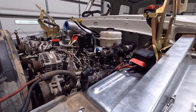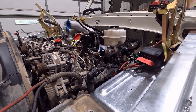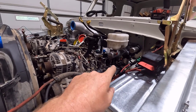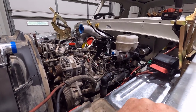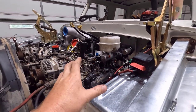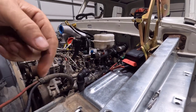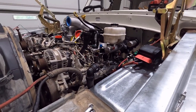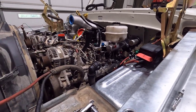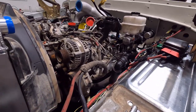We have lots of room for our brake lines in there. Clearance for the hoses is limited. The hydraulic hoses for the hydro boost are going to be tight because the ends on them are crimped on and don't have much flex — so I might have to do fittings to get them turned the right direction, then do straight ends on the hoses. A 90 on those hydraulic hoses takes up a lot of space. I also still have to sort out a reservoir for the power steering and the hydro boost. The factory 6.7 has just a little canister that goes right here — I might see if that works or just get an aftermarket canister.